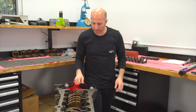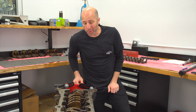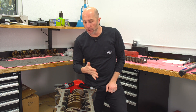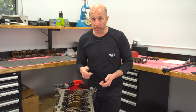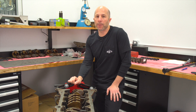So what's the determination? I would say that the PlastiGauge is totally doable. If you don't need to know the individual dimensions of the crank pin or the inner diameter of the bearing, for $7 you can double check all of the bearing clearances. I'd say use the PlastiGauge if you don't have the high-end mics — and even if you do have the high-end mics, if you're not calibrating them, the PlastiGauge might actually be more accurate. Thanks for watching, and if you like this content, consider subscribing.